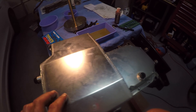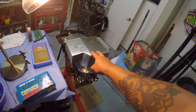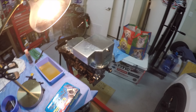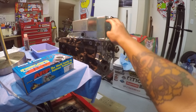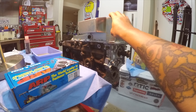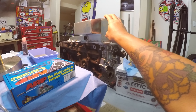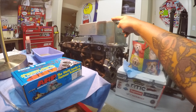For the 4AG 16 valve, I test fit the sump on here first — dry with no sealing — and put four bolts on that side to mount it and lock it in place. According to the MRP instructions, you rotate the crank to make sure the windage tray inside doesn't hit anything. On my 16 valve 4AG it rotated nicely with no mods needed, but if you feel binding you want to adjust the flaps on the windage tray so it doesn't hit the crank.